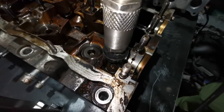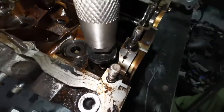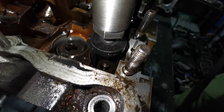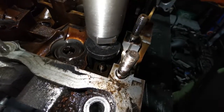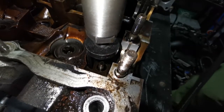It's central and concentric to the retainer. We'll start cracking on the pressure — there we go. We'll just fish out the keepers: there's one, and there's two. And back up the pressure.